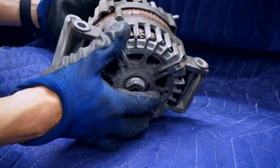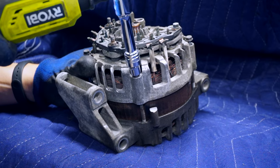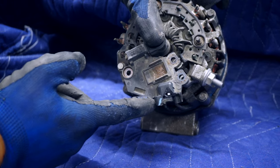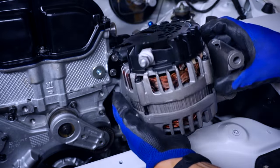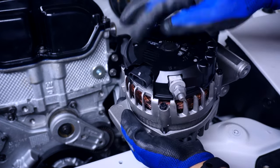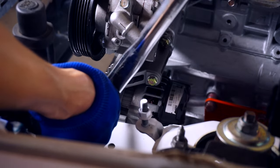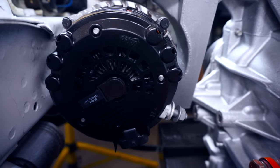Now we can rotate the housing 90 degrees counterclockwise. If we put the voltage regulator back into place for mock-up purposes, we can see that the plug is pointing to about the five o'clock position. And here it is — a freshly rebuilt alternator. A local store had this refurbished and over here they replaced the broken voltage regulator plug. The alternator is in and problem solved — great success.